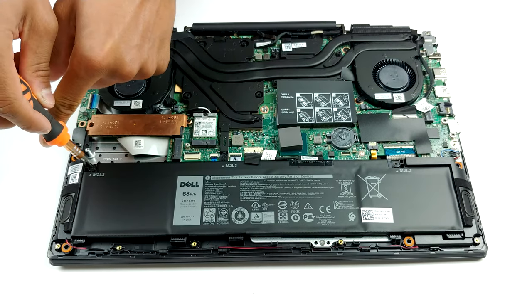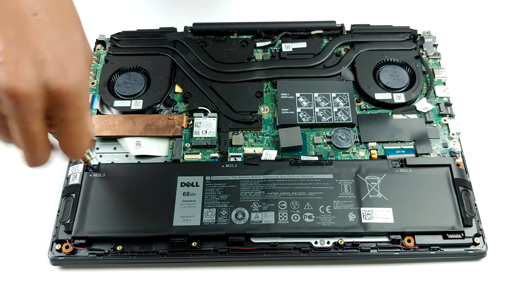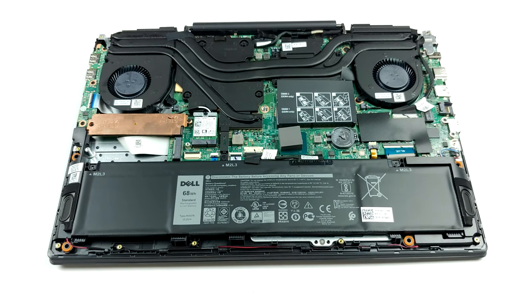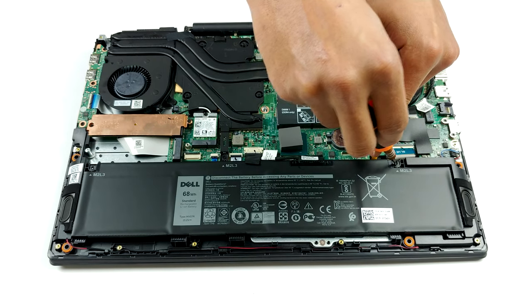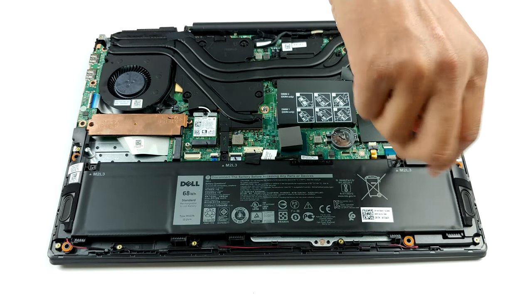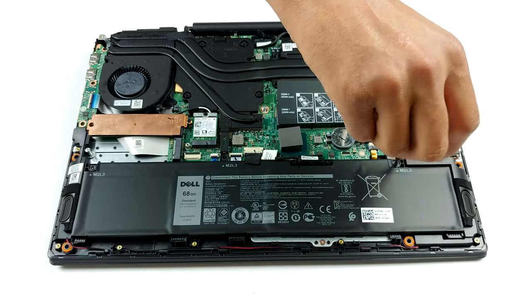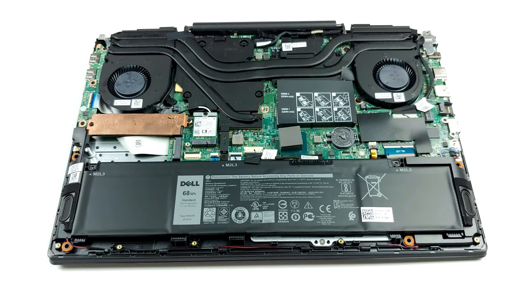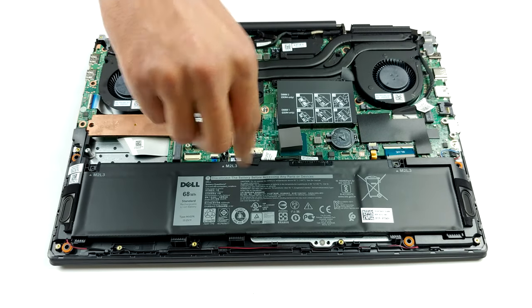Interestingly, Dell has switched from 4 heat sinks down to 2 for their G5 series. However, they employ an HP Omen-style fan, which is a lot thicker and can drive more air. Moreover, the 3 heat pipes are now significantly bulkier as well, and there are 2 metal plates dissipating the heat out of the graphics memory and the VRMs.